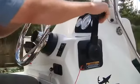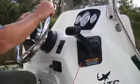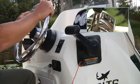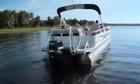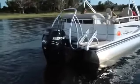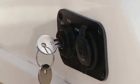When you come back to neutral, the lockout releases and you can shift normally. This procedure may be slightly different if your boat is equipped with a SmartCraft Digital Throttle and Shift System, or DTS. DTS is standard equipment on Mercury Verados and optional on some Mercury OptiMax engines. If it's cold, or this is the first start of the day, additional choking may be necessary.